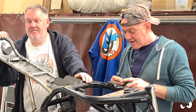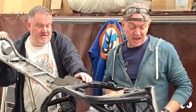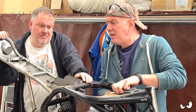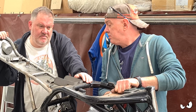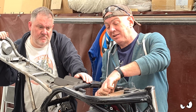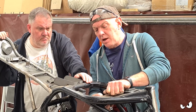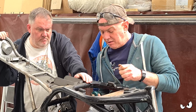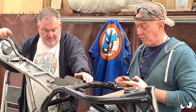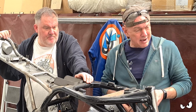He does, doesn't he? The carbs, we never pulled them apart. It was just a working set of carbs, as far as you knew. Well, it was a set of carbs, wasn't it? They're rubbish. So, Steve-O has got a set of 38 mils which should have been on this originally, and you had it running on them. That's what should be on the engine as stock, so the intention is they're going back on, because it's stock. It might not run brilliant because the jetting might not be right with this exhaust and pod filters and everything, but it will run. But at least we've got a base set, and then we can go from there.